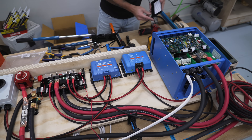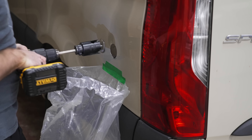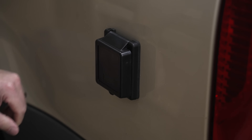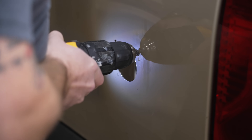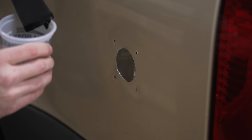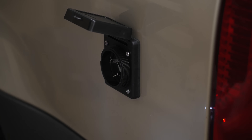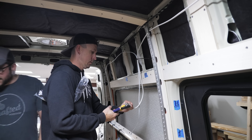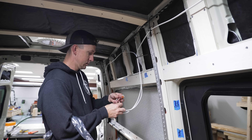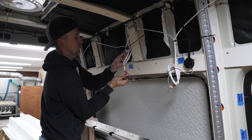Before bringing the panel into the van, we decided to go ahead and get the shore power inlet installed on the outside of the van, which meant drilling more holes. First drilling the larger hole for the inlet to fit through, then another series of holes for mounting. I used a center punch to mark the holes, which also kept the bit from wandering when drilling, and after drilling I sealed the holes with enamel paint to keep them from rusting. We also knocked out some of the branch circuits inside the van while we still had plenty of floor space, starting with the circuit for the USB chargers and gooseneck lights over the bed. We used 16-gauge wire for the lower-current DC circuits and 12-gauge wire for the higher-current DC and AC circuits.